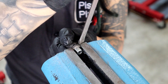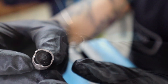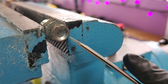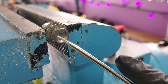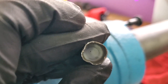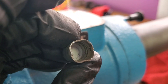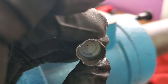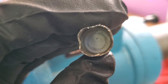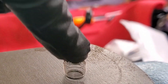Just because I'm curious, I'm going to open up this little diff vent and see what's inside. It's really interesting — you can actually see the moisture built up on this little seal here. There's a little spring inside. Look at all those little moisture droplets built up on the inside of the diff vent. As you can imagine, when water and diff fluid mix — similar to coolant and oil mixing with a blown head gasket — that's not good. It could damage the bearings inside your differential or transfer case. And look at this pathetic wimpy little spring.